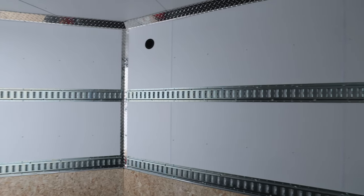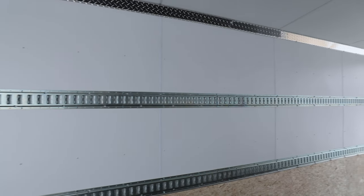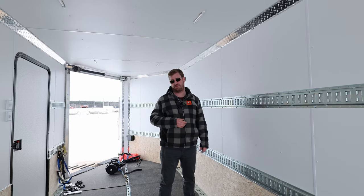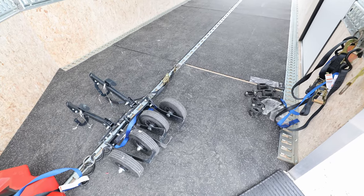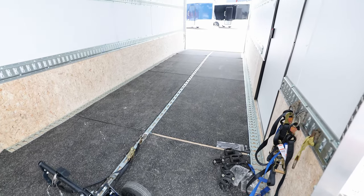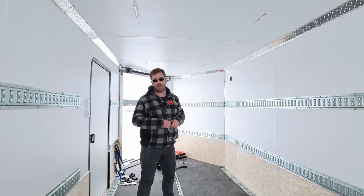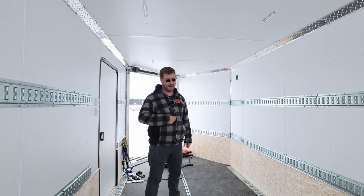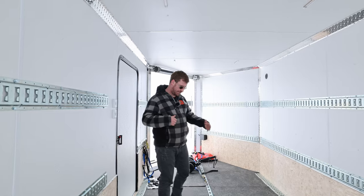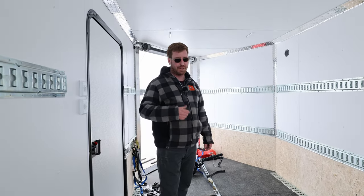On the walls I've done two rows of E-Track. When you think about it — if you're holding up a fridge, couches, whatever — some things are low, some things are high, and what that does is allow you to tie something to the wall and not have it tied down to the floor. E-Track comes in 10-foot sections and is super easy to install with self-tappers. The other thing I did is rubber mats — just generic half-inch rubber mats you can buy for a workout room, not too heavy to add weight, and easy to maneuver and cut — for the ski carbides and studs so they won't rip up the floor.